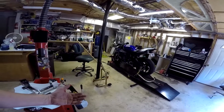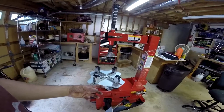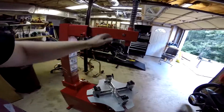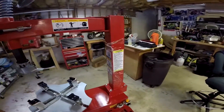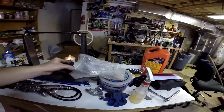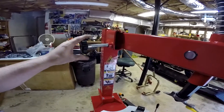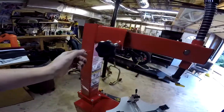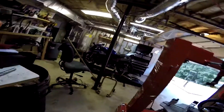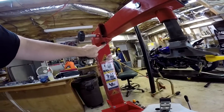For example, I just recently did a clutch job on someone's bike and had a problem — you'd let out the clutch and nothing happened. Turned out they were given the wrong parts. I was very thorough with that; I didn't just throw it in and say here you go. You need to make sure things work when you're done. This machine is going to be a wonderful addition to the shop. Next, we put the extremely goopy big screw in the hole — lots of lubrication. Then we loosen the pivot lock so the arm can actually pivot, since they lock it down during shipping. Just a little loosening of that nut and now it pivots freely.